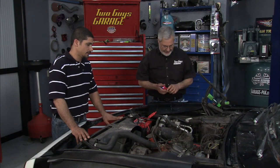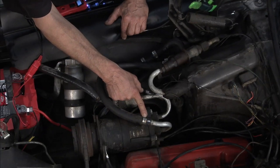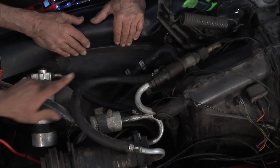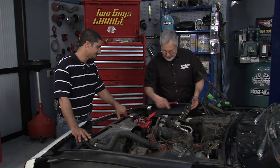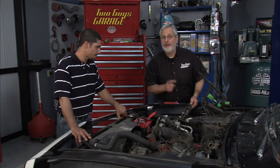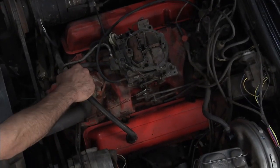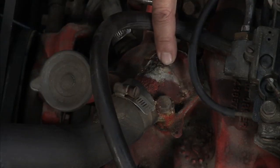This thing really needs a lot of work. Look at these vacuum lines. Look at the AC system — it's an old R12 system. We need to put new hoses on here with crimped ends. You never want to use radiator clamps — those aren't going to hold the pressure. It's got an old POA valve that works sort of like an orifice tube or an expansion valve — we need to replace that with a reproduction piece, flush out the system. It looks like the heater core is broken because they've looped it — put a loop in the heater hose system where it goes from the pump to the heater back to the manifold. When you see that, it's a sure bet the heater core was leaking. While we've got the dash out and the carpets out and half the glove box out, we'll put a new heater core in. It's also a good idea to replace all the hoses — the PCV hose is as hard as can be, the PCV valve needs to be replaced, the brake booster hose needs to be replaced. Go ahead and replace the radiator hoses as well. You can see the radiator neck has been corroded and leaking — electrolysis from 20 years of sitting. The radiator is going to be eaten up, so we'll put another one in.